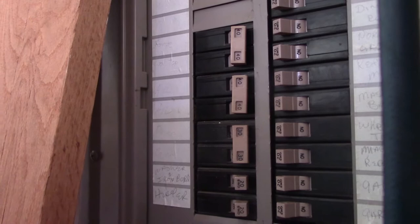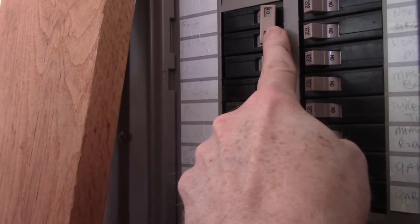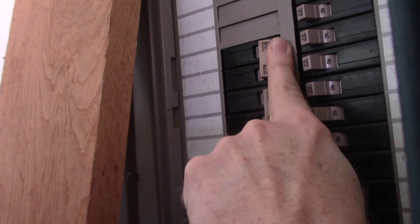This is a big job — it's going to be a two-person job for sure. You need to take the doors off, take the shelves and racks out of the oven first, and remove the screws that hold the frame in place in the cutout in your cabinet. Then we're going to have a platform to receive the oven to hold it, because it's a couple hundred pounds dead weight. The number one most critical safety thing is to make sure that we cut the power to the oven at the circuit breaker — this coupled dual 40-amp breaker — to eliminate any risk of personal electrical injury.